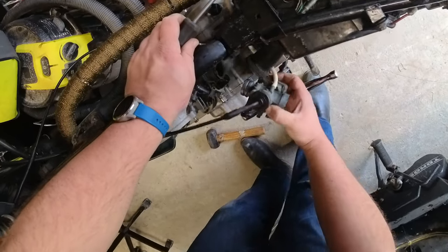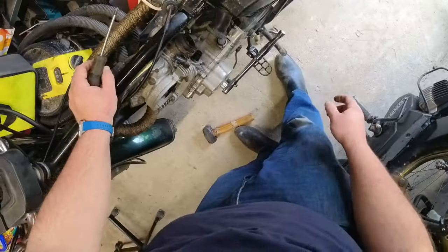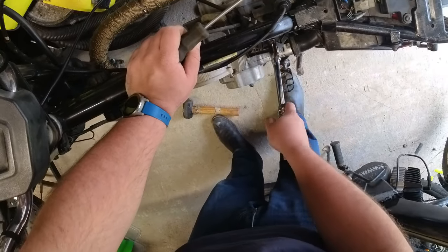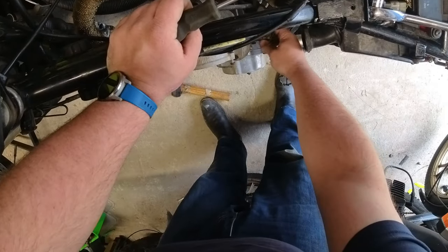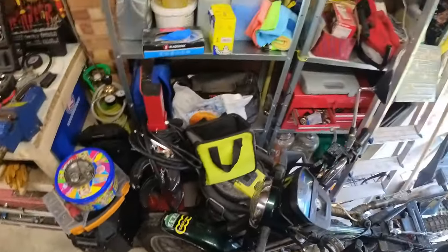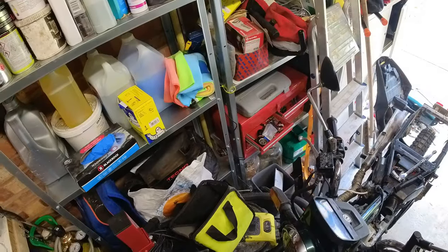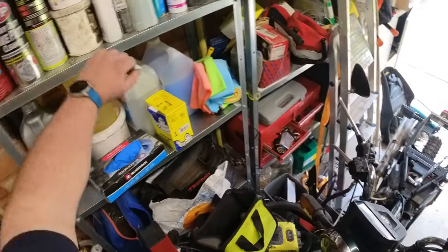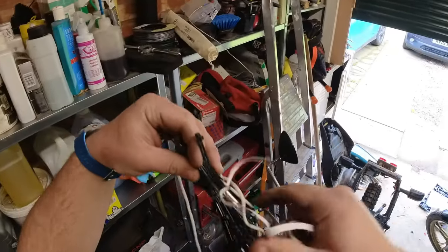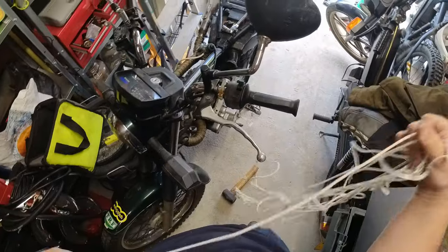So I'm going to take the side cover off later just to double check and see if anything fell down there - better safe than sorry and it's only a few screws. It gives me a chance to check out the state of everything under there as well, pun fully intended because that's where the stator lives. You can see now I'm just taking apart some of the ancillary stuff to give myself access. I've popped the carbs off and now I can get my big wrench in to loosen that cover which just screws off, and then underneath is the cam chain tensioner assembly. It has a free floating pin on the end of the plunger. You tighten it up until the plunger pokes out a certain amount and that plunger floats with the spoons that hold the cam chain - so as you're tensioning it you're putting pressure on that spring until the end of the plunger pops out. That's when you know there's a balance between the spring and the plunger position and therefore the right amount of cam chain tension. It's very clever.